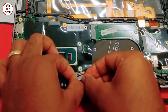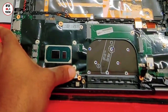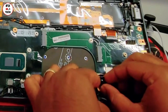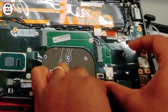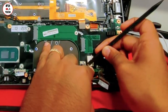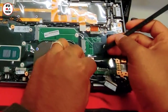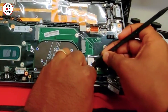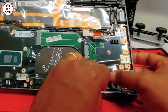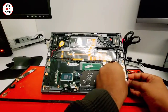Now we're going to connect the LCD display — just put it in place and press all the way in. Now the one on the right side: this is the power button cable, also controls the fingerprint. You want to do it carefully, don't break it. This is the antennas — they can be a little tricky. Just put it on top and use your tool to press all the way down. Same thing with the other one. This is the mic and camera cable — for some reason it was held with tape, but let's put it back and make sure it is connected properly.